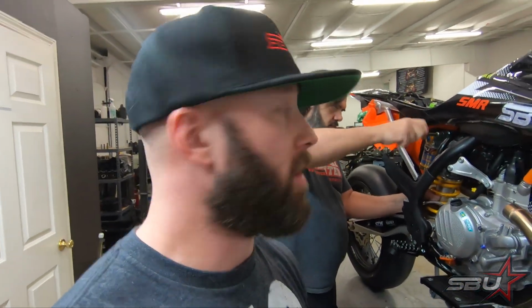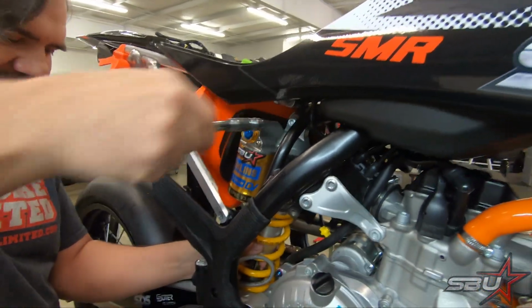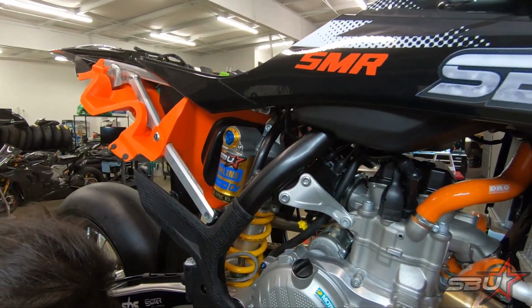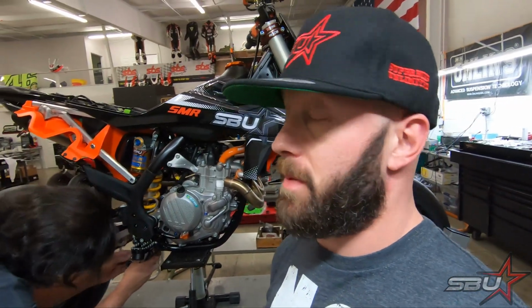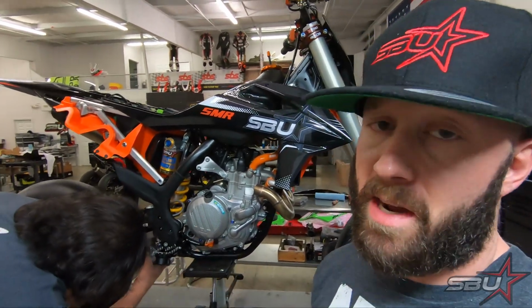We're gonna replace those bolts. They're a unique thread pitch. They're 10 by 1.5. You're probably wondering why are they still using those heavy bolts? That's because we just don't have any 10 by 1.5 bolts in stock, so we're gonna have to get some from either Zeta or ProBolt, which is another supplier that we use. If Zeta doesn't have something, we'll often just grab it from ProBolt. They're here in the US and they have all kinds of crazy odds and ends like that.